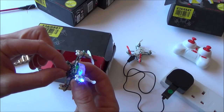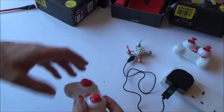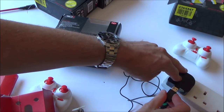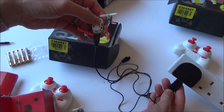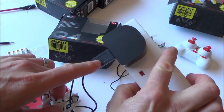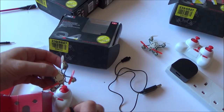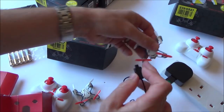It is also possible that maybe the battery is going to be damaged on all of these. Oh here we go, excellent - there's definitely life in that one there. So again, that one does come with the cable as well. I'm going to swap this cable over just to see if it's going to accept the charge. No. But yet if I was to plug it into this one, which looks like it has got life in it - there you go, see the red lights come up there. So this one could be a faulty battery. Let me just test the lead - yeah, the red lights come on there as well, so I know the leads are okay. So it might be as simple as a faulty battery in here.